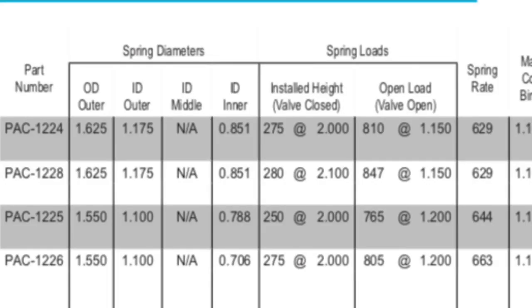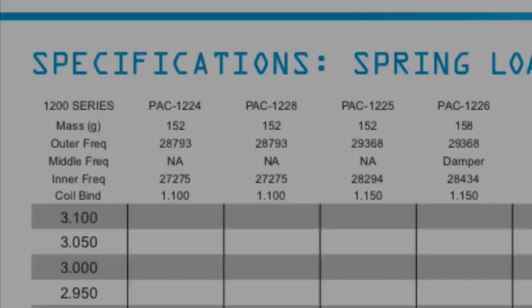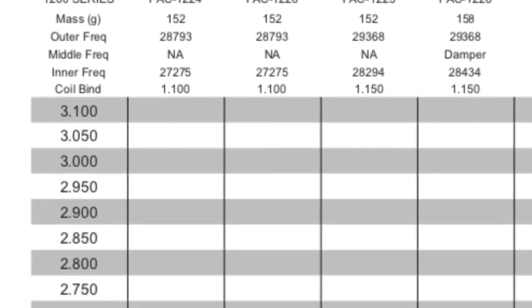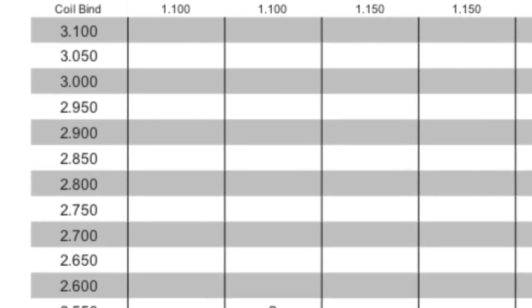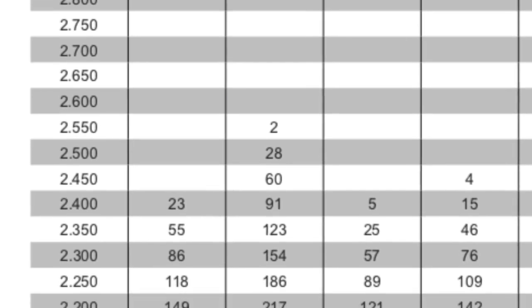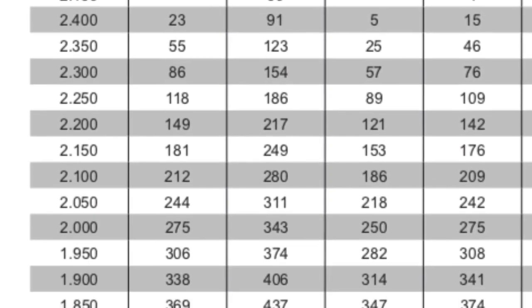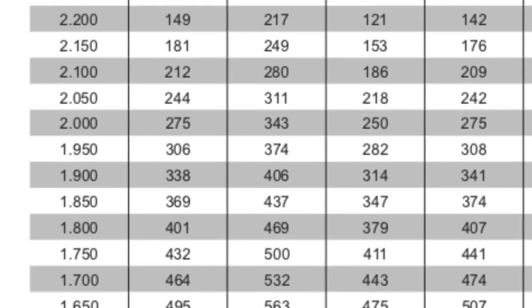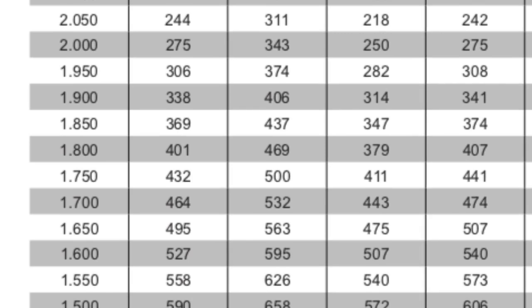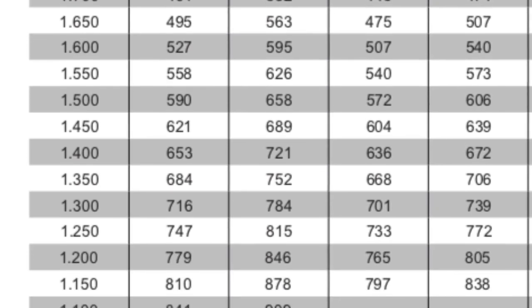Here's the spring chart for mine — it's the bottom one, the PAC 1226. Here are the specs for them. This chart is the spring rate chart showing at what installed height you get what spring pressure. Mine is on the right-hand side. When you get to 1.90 — which is my installed height — you can see it's got 341 pounds on the seat. Coil bind for these springs is 1.15 inches. My camshaft is only 700 lift. So if I had installed these springs at the recommended two-inch height, at max lobe lift I would not have compressed the spring enough, and the maximum open pressure would have been about 65 pounds less. That is the reason I used an installed height of 1.90 instead of 2 inches.